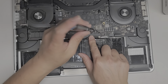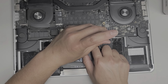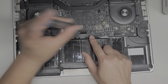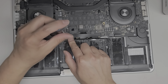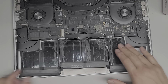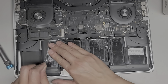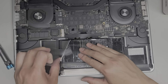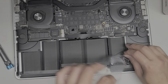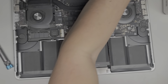It helps to put one screw in first just loosely, then get the other one — if you need to move the battery around, you can. Then hold it in place and tighten that down. Same thing with the other side — tighten that down. Once you've got it all in place, push down the battery pack and then peel off this clear layer just like this.